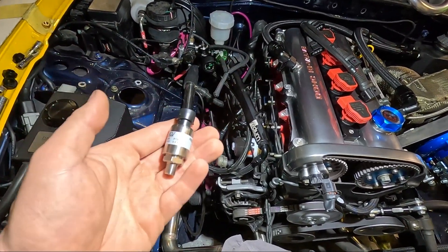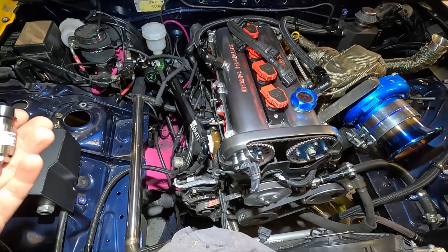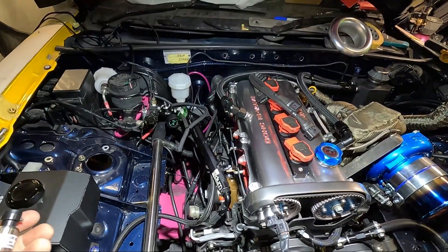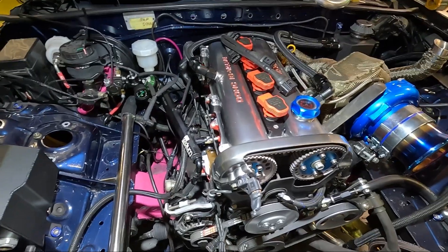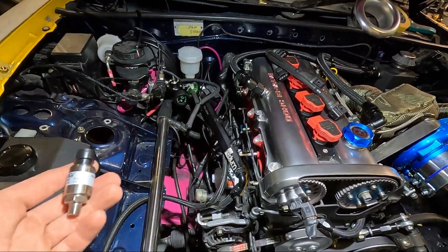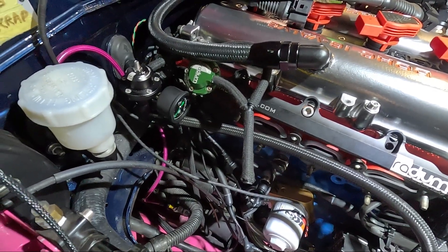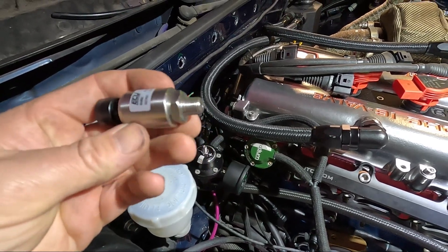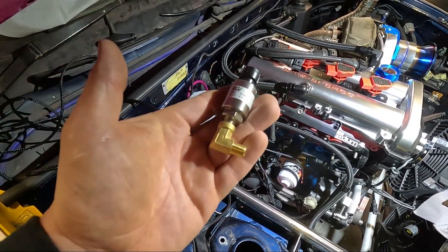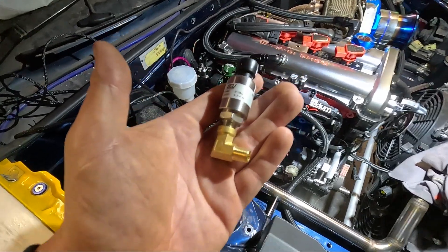If for whatever reason I lose fuel pressure, because this sensor is linked to the ECU, it's going to pull all the power out of the engine and hopefully save it. When your fuel pressure runs low — for instance if you run out of fuel, or you're cornering too hard with too little fuel in the tank, or your fuel pump starts failing — you're going to lose fuel pressure. All of these will cause the engine to run far too lean, which could lead to detonation and serious engine issues. But there's a little problem: because of the way I've set the regulator, damper, and pressure gauge up, the spare port is on the back of the regulator and the sensor is going to hit the bulkhead. To overcome this, I'm going to put a 90-degree fitting on the end so the sensor sits at the right angle and doesn't foul on the bulkhead. I'll put some sealant on that 90 and install it in the regulator.